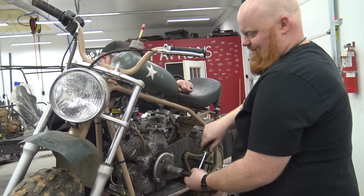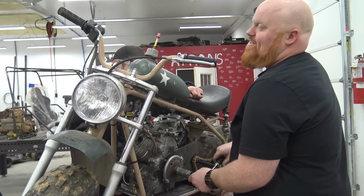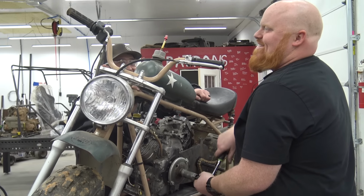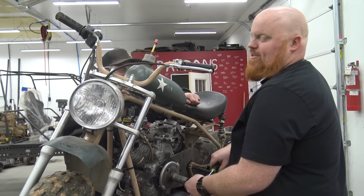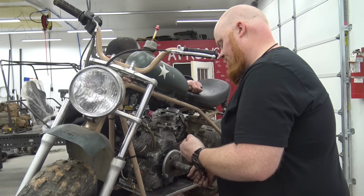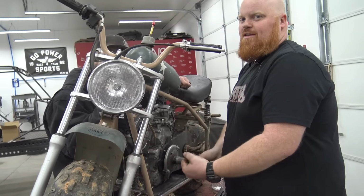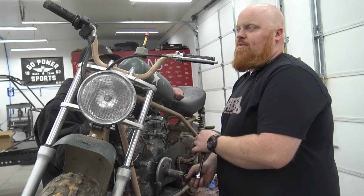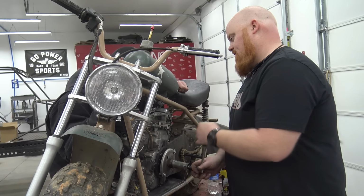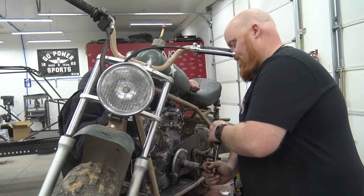That did sound like something broke. It was just the crust in there. So we found out that the inside of this crankshaft isn't threaded, because it was an externally threaded crankshaft. So me and George here had to drill it out, and now we're tapping it with a fine thread 3/8. So we'll be able to thread this pulley on, then get to making the exhaust.